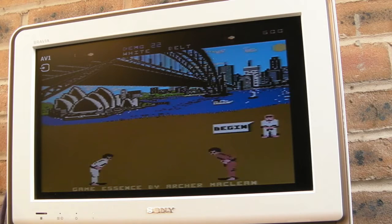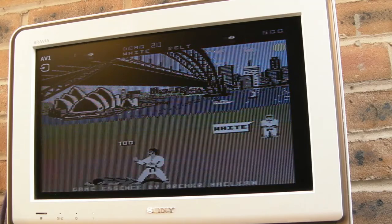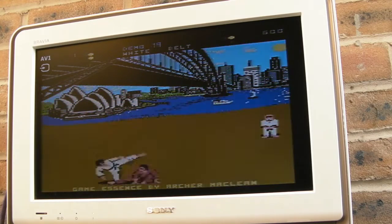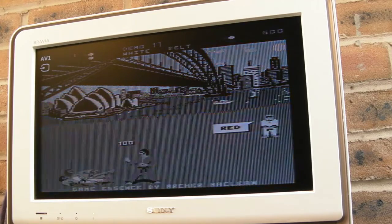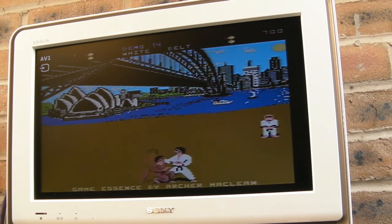Maybe it's the transistor just below. Look, colour starts coming and going, coming and going. And that kind of makes sense. The bottom crystal is for the PAL. Maybe it's that crystal that's the problem. And the one above is the main crystal, which goes into Antic or wherever it gets divided out, I think.